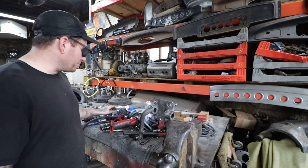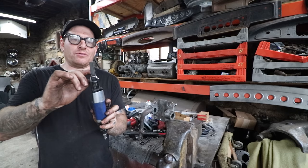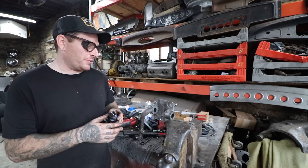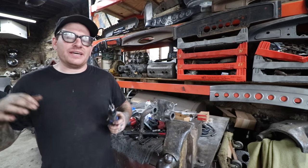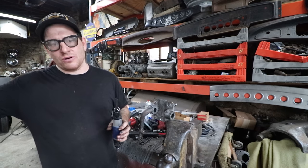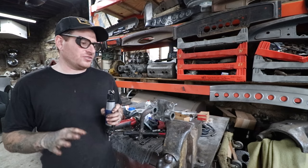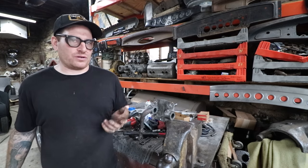Like I said, the option, if it does get stuck and you have one that's a little tricky, it's easier to just take a little hacksaw blade, put it in your body saw, put a little slit in it, and that will relieve the pressure and knock it out. Instead of trying to use a press and getting yourself in trouble trying to press something in and maybe getting stuck, this is a little bit easier and is the path of least resistance that works for me.